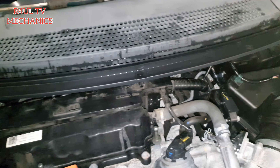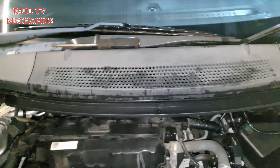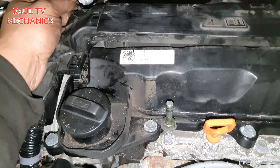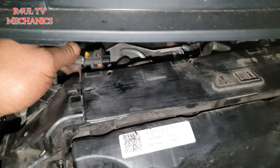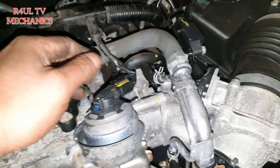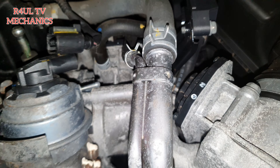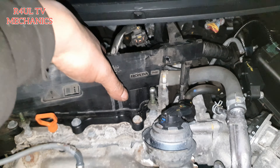The proper way to do it is take the wiper arms off and everything, but we're not gonna do it that way. We're gonna take this wiring loom off from here. You've got a plug going onto the high-pressure rail, then all the injector plugs — take them off. There's also a little breather pipe going on to there — took that off as well.